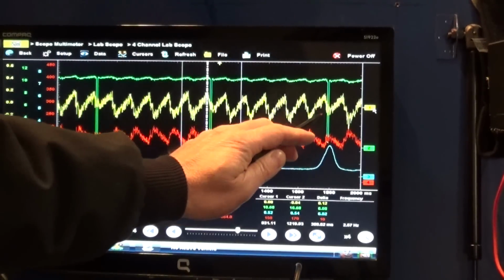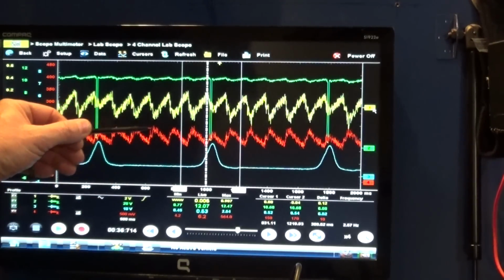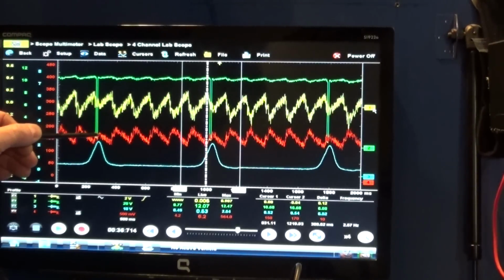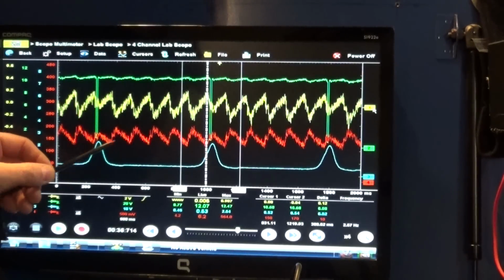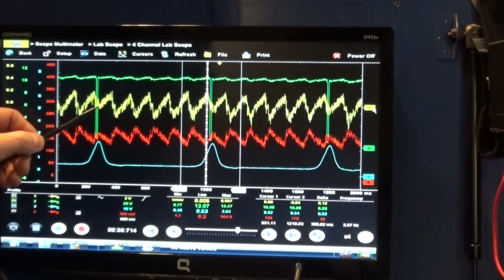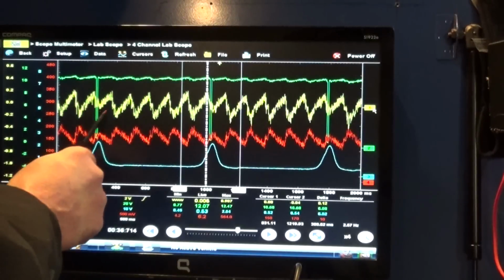And now, as we can see right here, this is what you want to look at. If you do this, you're basically looking at the bottom of your trace. So now we can see that our voltage did not drop, because our current did not go up to, I think it was 190 amps, eventually 160 or 150. So our voltage did not drop that much. If we see this on our trace, this is our problem right there.